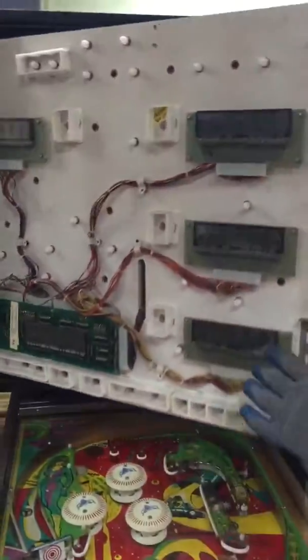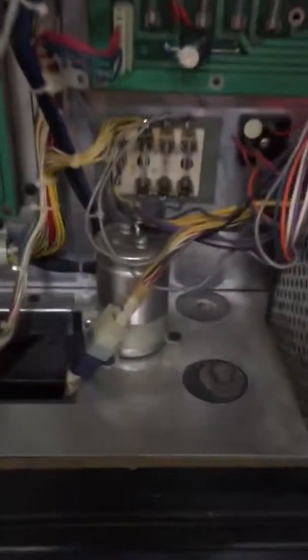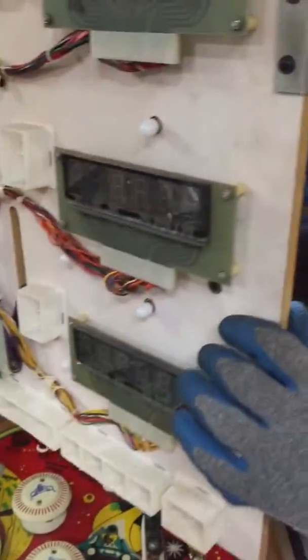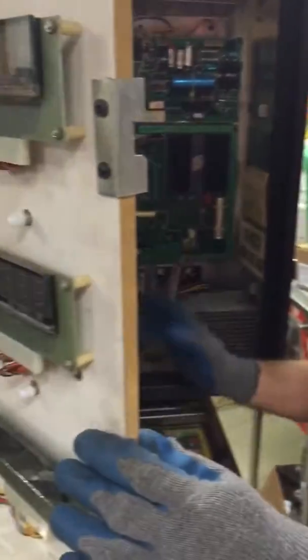Now, as you see, I'm going to open up the back box, and here are the bolts I need to remove. This one has a few bolts in it. Now, as soon as I'm done removing these bolts, as I said, we're still going to hang on to the back box on top of the machine. We're going to close the door, put the glass back in it, and we're going to shrink wrap it while it's basically balancing on the machine. So we have to be very careful.